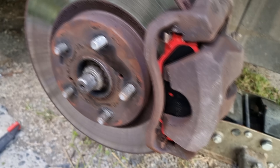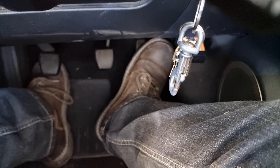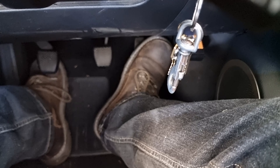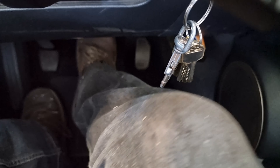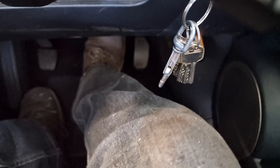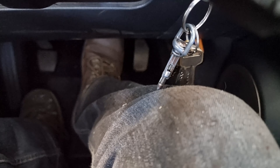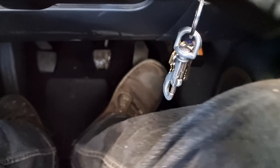Now I'll put this wheel on, but first a very important step — don't forget to do this. Once the brake pads are changed, start the car first so the vacuum on the brake boost is working, and get a proper brake. That's all the way to the floor — do that two or three times. Start the pedal now — you've got a good hard push. It's back to normal. If you don't do that, then you've got zero brakes when you go to drive.